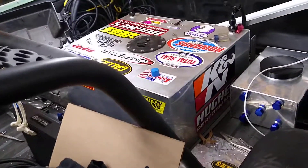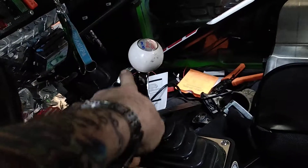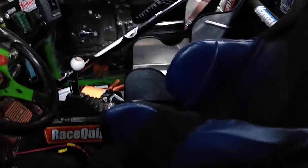When I really want to get after it hard, the nitrous is going to help cool the motor as well. Battery is going to go back over in that corner — I've got a weight box to go back there if I ever decide to race. It's just a toy, a hot rod, but I may take it out and race it, take it on the street or the track and see what happens. Going to make a bracket for the nitrous button — I want it on a button, not on the carburetor, right behind the shifter. I'll put the purge button up there somewhere. Only thing I want on the steering wheel is line lock and trans brake.